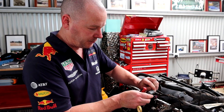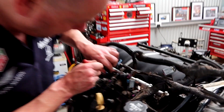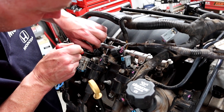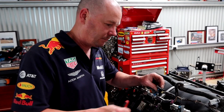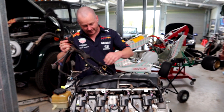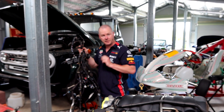These little injector pigtails have got this little grey clip that goes up and down, and then it's really hard to get the actual injector pigtail off. It's a two step process — get the hook under here and lift up that little grey clip, then use your little heart surgery tool to get under and pull it off. Just like that. Take your time with it because they're going to be really hard on there and you don't want to be reefing and trying to pull them off and crack them. Once you've undone all your plugs and made sure you haven't broken any clips, pull the wiring harness off and put it into a separate box, making sure you've got all your retaining little plastic clips and don't lose anything.